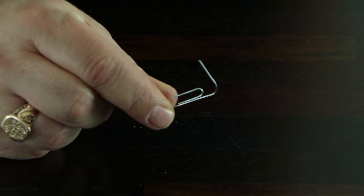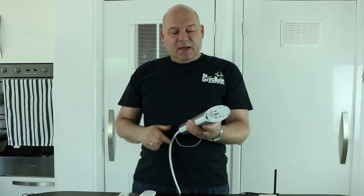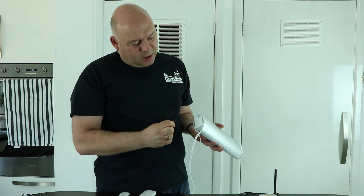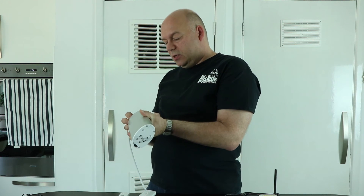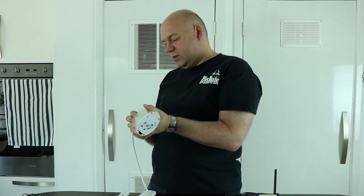The magic tool is honestly a paper clip — the amount of uses I've found in my career for paper clips is unbelievable. We'll open this again, and if you look here there's a little hole. You hold the paper clip in there until the motor jogs three times, and then it will be reset to factory default.